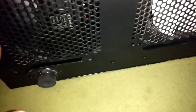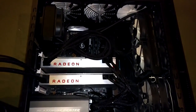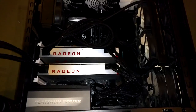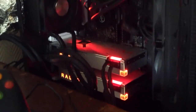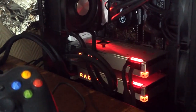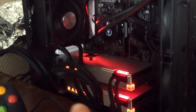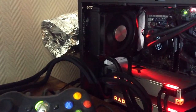I'll clean the dust filter and put it together. All in all, this huge case is starting to look quite populated and I like it. I've got the system running now, and the bottom card turns off when Crossfire mode is enabled and you don't use it on the desktop - the red bars go down until only one is lit green, and the Radeon logo turns completely off, signaling the secondary GPU is in zero power mode.